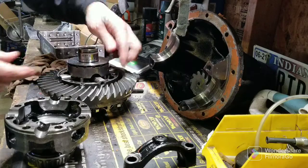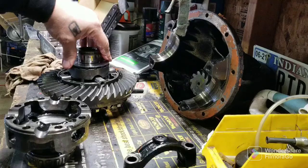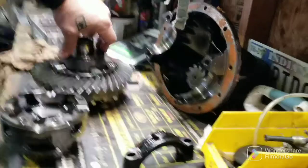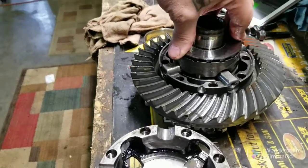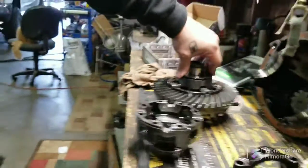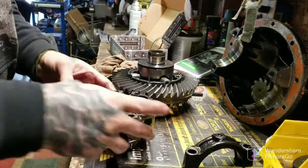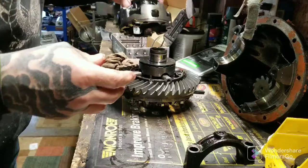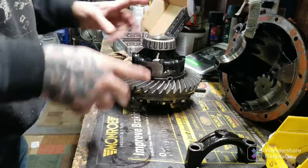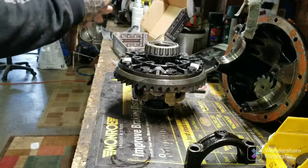As I flip this over, you can actually even pop that spider gear back out. Put this all together. There are springies in separate spots — put your other two springs in these little notches. Easy peasy. It's all lined up like it goes. You can see here the difference — my hands are all greasy, but you can see it pushing there. That's what allows it to skip around. Basically, bolt this back on, turn this over, put my bolts back in, and torque them.